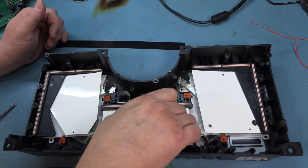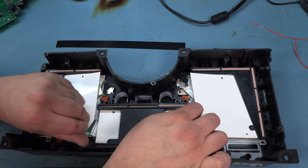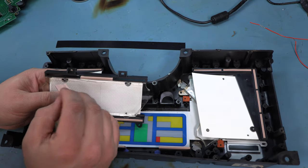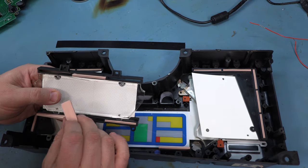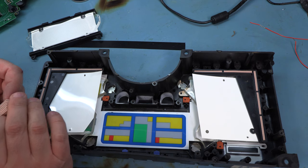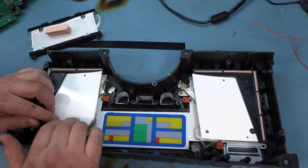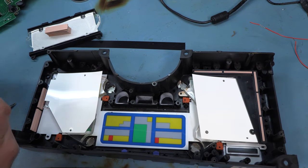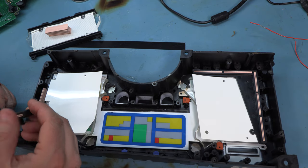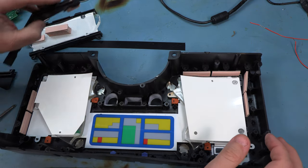What I'm going to do is pull the center light diffuser and look at the other side of those blocks, because I am curious what's going on here. I see a hair — that could certainly be a reason that some of those segments were not working. So we're going to pull those six out and clean those up. There's a little bit of debris that might be causing this problem. I definitely see some debris here. Even though we didn't have any problems on the speedometer side, we've definitely got some debris there, so I'm just going to clean these a little bit and see if we can get it working again.